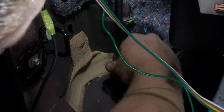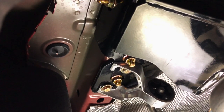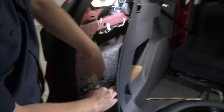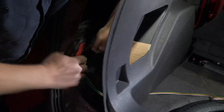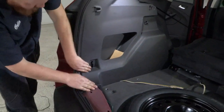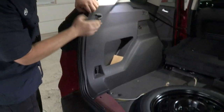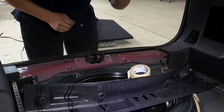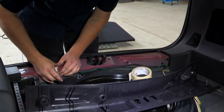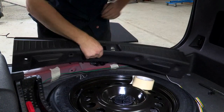What we're going to do is run our power wire out through this grommet to get it underneath — I'm just going to poke a hole in it just like that, and then start running this end of our wire through. We just have our wires here, so I'm going to put a zip tie or two around them to keep them all together. Now that our wires are together, we're going to go ahead and put our panel back, making sure our grommet sits on the outside. We're getting ready to put our threshold back. We still have quite a bit of slack here — we don't want that to be exposed, so we're going to use a little bit of scotch tape to hide it out of the way once we put our panel back. That should hide our wiring nicely.